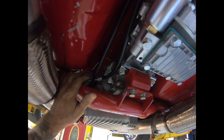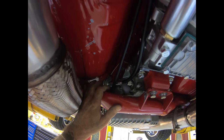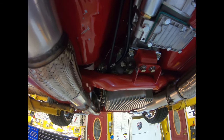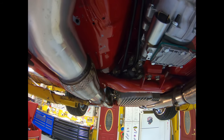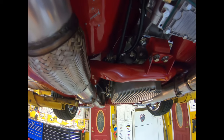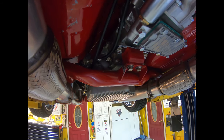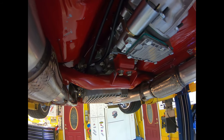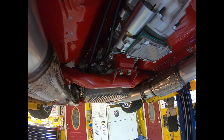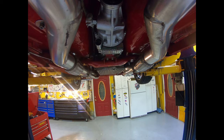What this is going to do is tell us when we're below 15 miles an hour, and it'll automatically shut itself off so that it goes back into regular first without the overdrive on. So you could put it in automatic mode or even in manual mode, and it'll still shut itself down. When you're in first gear at a stoplight, it'll drop back down into first gear without the overdrive on. Pretty neat unit.